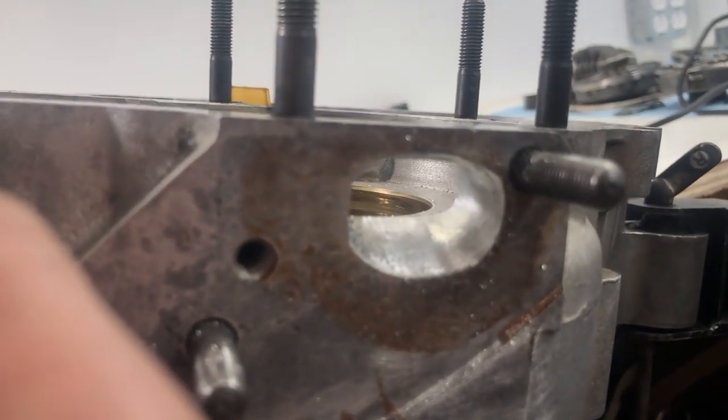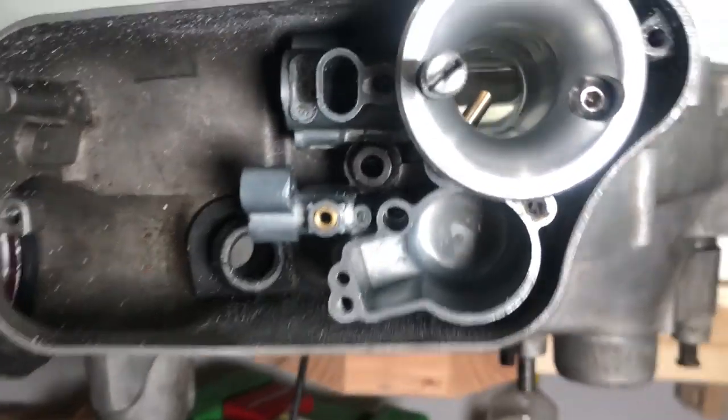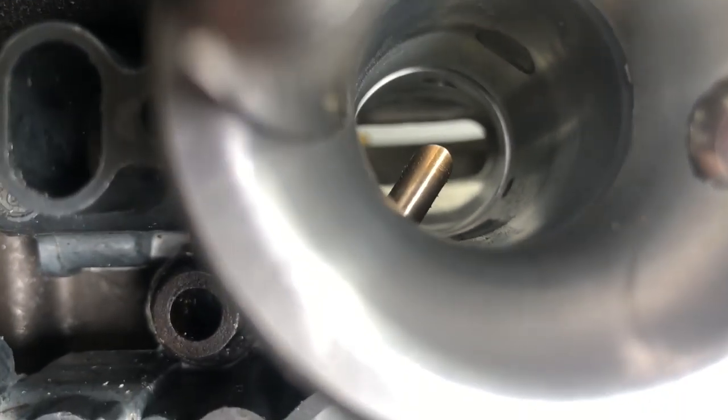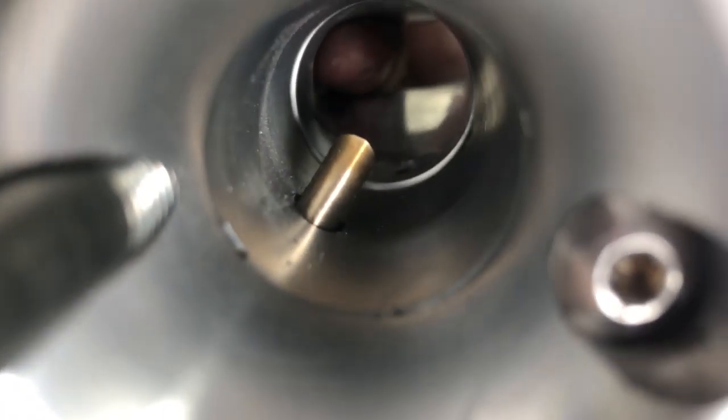The bike was going to stay rotary and the rotary pad was fine. So I cleaned up the intake and made it a little bit larger, but not longer. I matched everything to each other — intake to carb box, carb box to carburetor, and then venturi to carburetor. Like everything from the top down was matched with as little imperfection as possible. This is one of the first times where I really put work into this and I'm quite happy with the result. Usually I'm a reed valve guy, but this really got me sucked into rotary intakes and I'm quite happy the way it turned out.